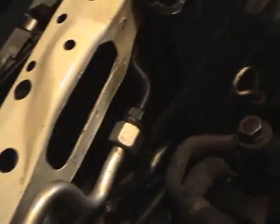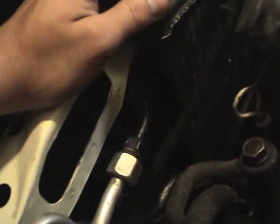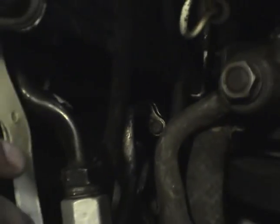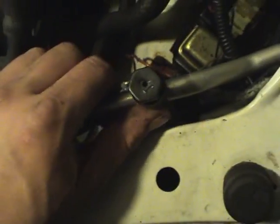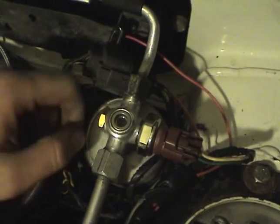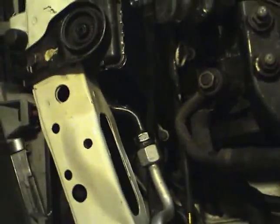The condenser was my stock 1.5 liter condenser — it's in front of the radiator. Here's the high pressure line with an O-ring, and the other line on the bottom also has an O-ring. Here's the retrofit fitting on the high line — follow the high line and it goes directly into the compressor discharge. Out of the other side of the compressor is the suction line, which goes behind the intake manifold firewall and into the evaporator — two O-rings there. Coming out of the evaporator is another line going into the dryer. Here's the brand new dryer from Mitsubishi — $100, comes with a new dual pressure valve. You also have to buy an O-ring on each side, then follow the dryer line back into the other side of the condenser. That's the AC system.